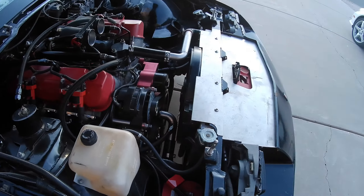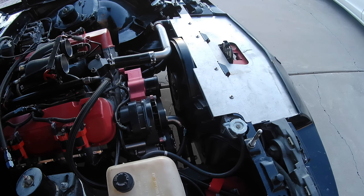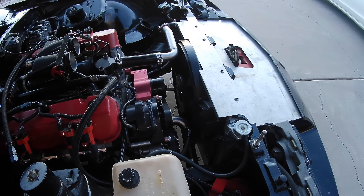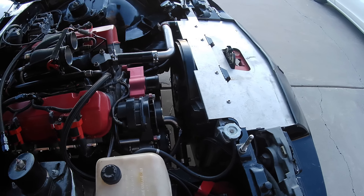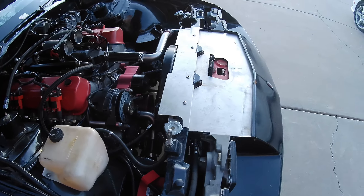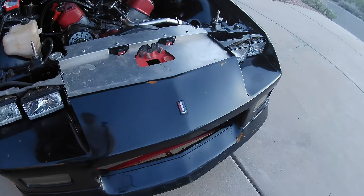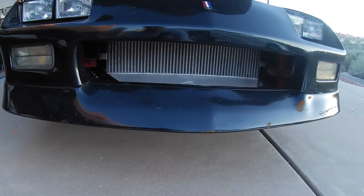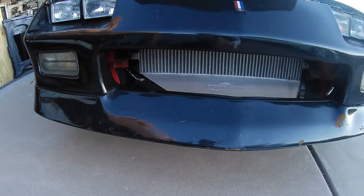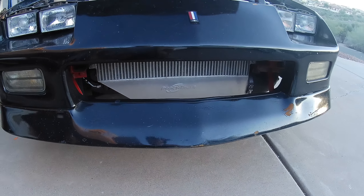I started out by moving to a single big radiator fan — I have a separate video on this 850-watt fan — but I knew I needed a big fan to keep the car cool with the added heat load from the condenser. As far as the condenser, I learned that you can't really go too big, so I found one that fit the entire radiator opening. It's behind the intercooler and basically covers the entire front of the radiator.